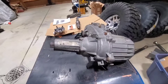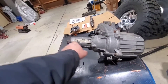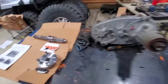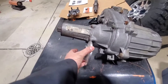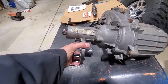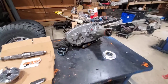Basically, in a nutshell, this long snout comes off. The T-case will be disassembled and the main output shaft is taken out. The shorter shaft from Tom Woods is then assembled into the case, and this becomes the new end point. You'll have the output flange sticking out roughly right here, and now we can use a conventional double cardan drive shaft and have it work the way it should. Let's get started.